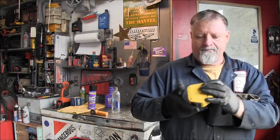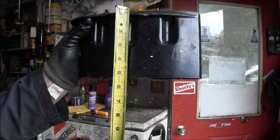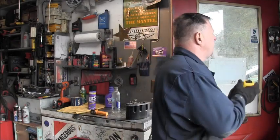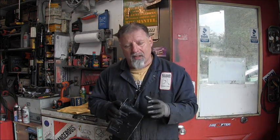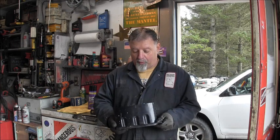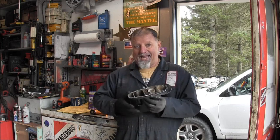So this piece is about 5 inches that you're taking out of there to make it a short shaft. The reason why you don't want to sit there and bang on that piece while you're splitting this apart is, if it's been in salt water, for sure. Fresh water, I wouldn't say it would be that big a problem. But if they've been in salt water and sitting, and these things are 30-something years old, when they've been in salt water like that, you will not be able to bang this piece out of there with a hammer, this water tube that you're going to turn into a short shaft.